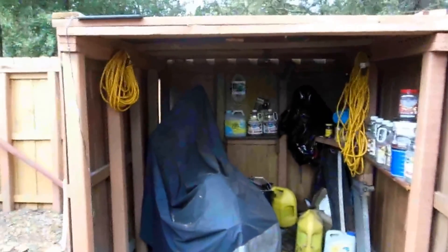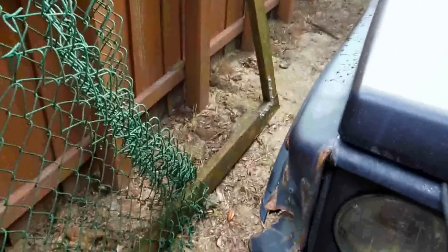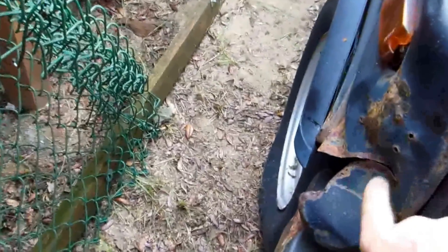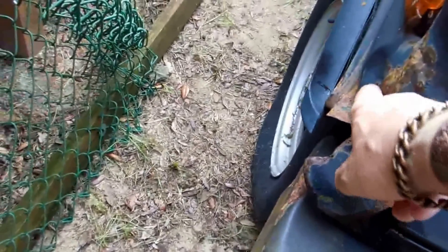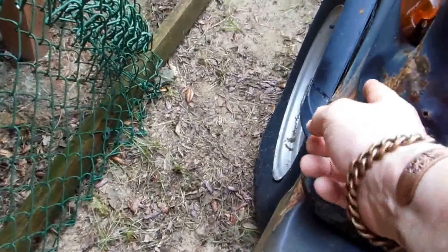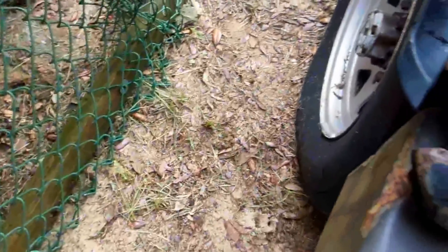You can see where my bike is — the corners are braced up with shelves and this thing is built. I think the house would blow over before this thing does. I'm also going to use it as a dent puller. I've got a dent here — this is the only dent in my Jeep and I'm not going to replace the fender. I can use the ratchet puller, put it in with a washer behind it, attach it to the 4x4 post which is all tied in, and it'll make a great dent puller. I can pull that dent out real easy using this framework.